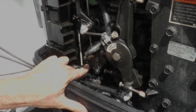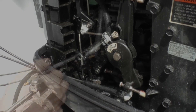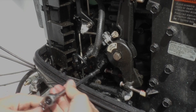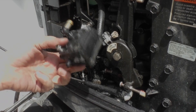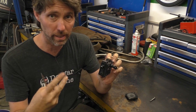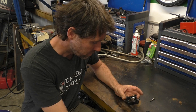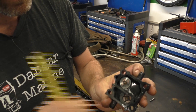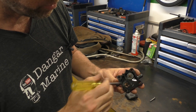There's a hose clamp here and another cable tie down here, so I'll undo those and then undo these four 8mm bolts. Let's get this over to the bench. This inlet hose comes into the middle section, so I'll need to separate the two halves to see if there's any debris caught in there. It actually looks reasonably clear — just one little piece of it. Not a lot of debris, but it's good to get that out before we call this fixed.